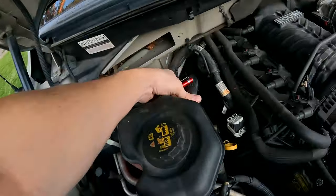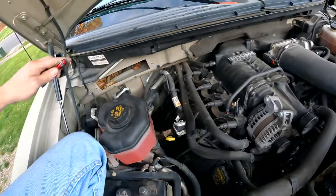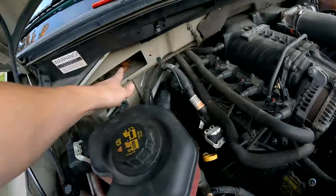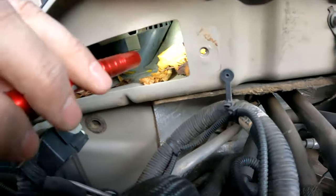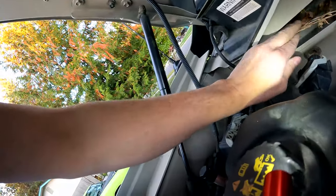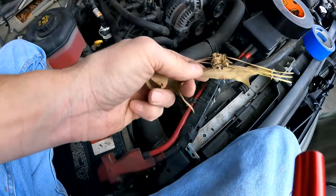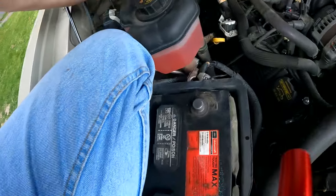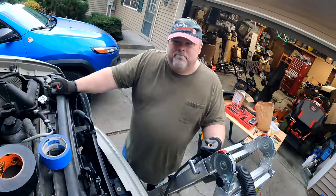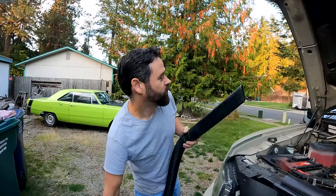So we tried — Tom's like, don't break your cooler. But even without that in the way, you're not going to get a vacuum in there — there's just a dome in the back. I knew there was a whole crapload of leaves out there that we couldn't suck up from the front. So we just got an air hose and sprayed in here along that side so that it blew those out and around. And look at all the crap that came out of here! These leaves right here, wherever this truck's from — this is what's broken apart and gotten down in there and totally clogged that up. So we're going to put that back so we don't litter, and we're going to suck that up. That is way more results than we got doing anything else. Let's save you some time — let's get this back in. This time we've got all those leaves out.